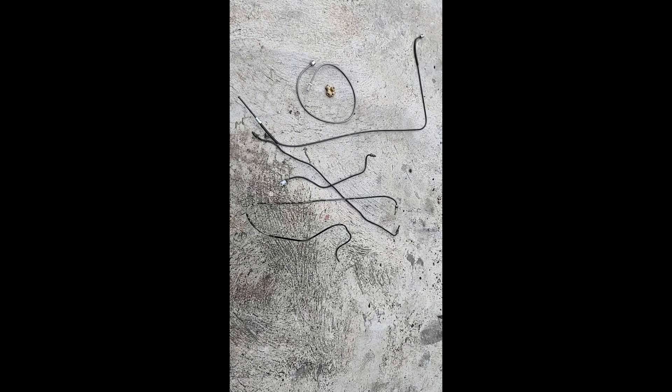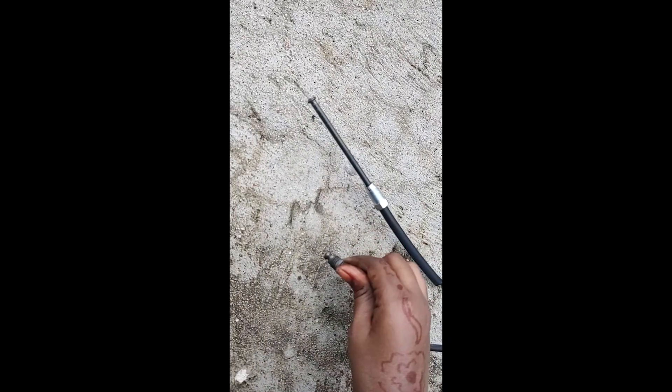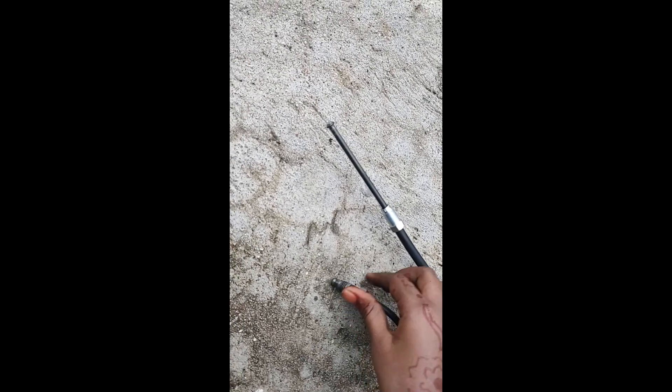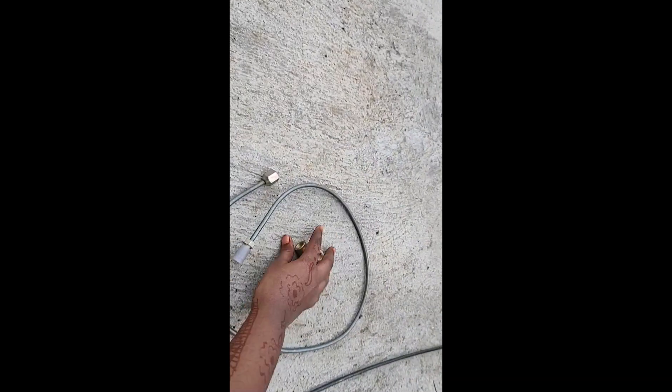The other difference is with the metallic brake lines. As you can see, this old brake line has a rough thread, and the new ones have a fine thread. You have to buy this T-junction to support the fine thread.